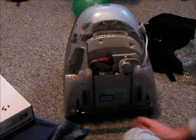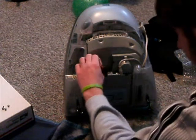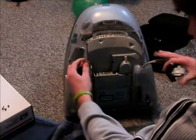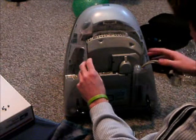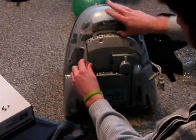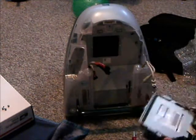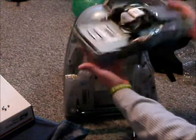The screw fell down — it always falls down when I try to take it out, but that can come off and out. Now the next part is always just slightly tricky. You have to make sure all your cables stay off to the sides, and the whole motherboard unit just lifts straight up and out. Now you have the brains of the iMac in the palm of your hand.